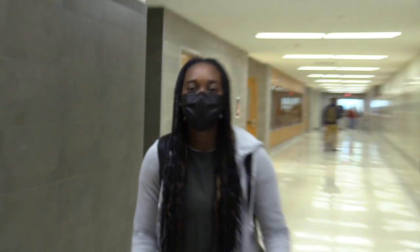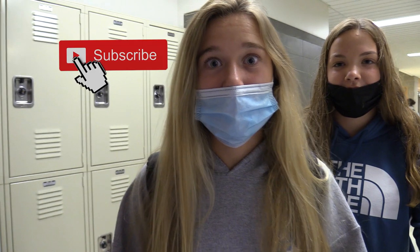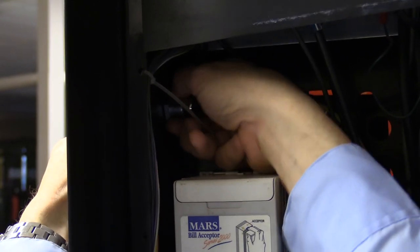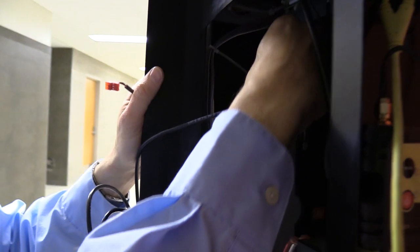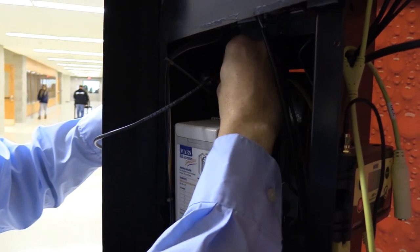The kit comes with a double-sided key — on and off. Now for the two connectors that go on the switch: it doesn't really matter which one you put where, since it's just an on/off switch. I'll put them on like that. Now looking at the instructions, it says to plug this connector into pins four and five on the board, which appears to be way up at the top of the control board.